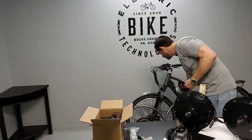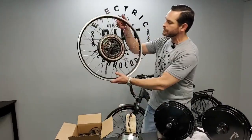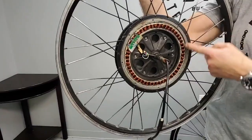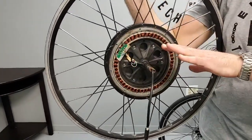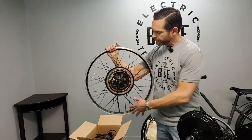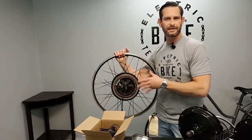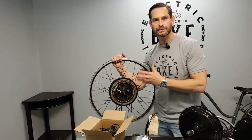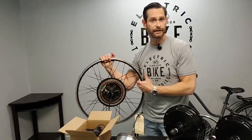So that's the Performance geared motor. Direct drive — what do the insides look like? This one's already inside: we have a stator, and then the outer shell. What happens is you have two sets of rare earth magnets — they never touch. When you electrify them, they go one way or the other, which is also one of the reasons we can do reverse on this. A direct drive motor is a bit heavier and has a larger diameter, so less stealth, but it's super durable. You can handle up to 600 pounds — it's not going to break because there's nothing to break. It's only a magnetic field.